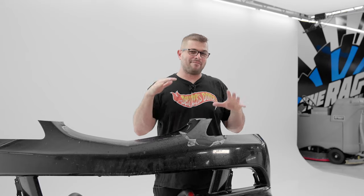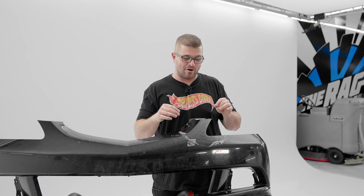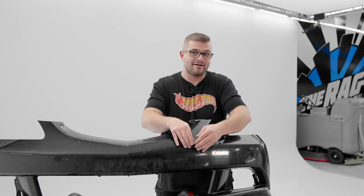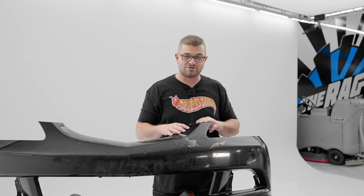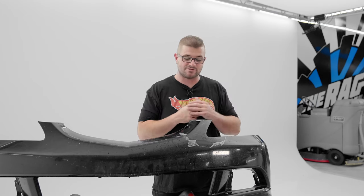Now, if the film becomes too hot, I'm finding that it's starting to stretch way too much and then it snaps. If the film is too cold, then I'm not able to get enough pull to start getting that adhesive removed. I start leaving a bunch of adhesive left over. So it's that perfect amount of heat that I'm looking for to where it's leaving the film pliable, it's taking the adhesive with it, but it's not getting too hot, it's not getting too cold. And I've been trying to just kind of balance between those two.